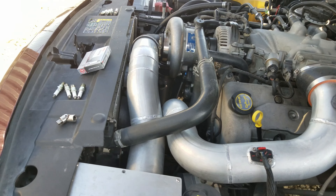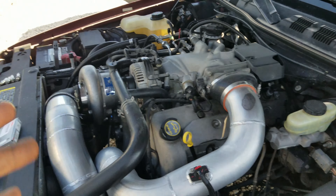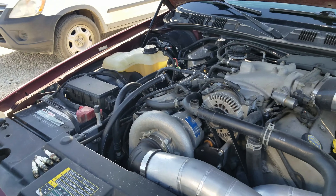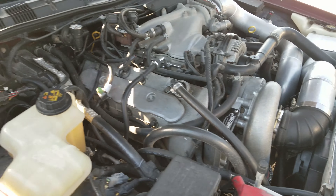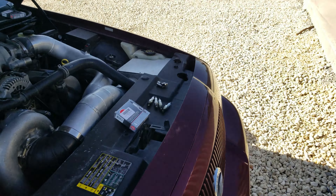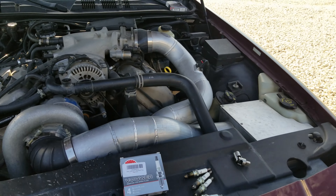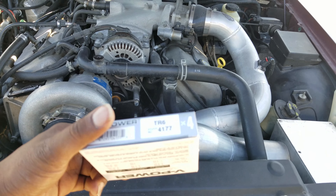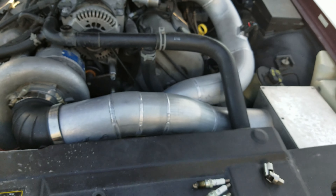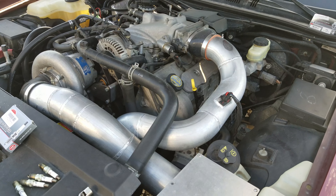Naturally aspirated, about 0.054 to 0.055 inch works. If you have an outrageously good aftermarket coil, you can sometimes gap a little larger. I love the one-step colder plug — sometimes you can go another step colder for higher horsepower gasoline applications, but on E85 I've kept it to this setup and it's worked well. The TR6 code 4177 is the number — you'll need eight for a V8. Don't forget to like and subscribe, and spread this to your modular motor friends.